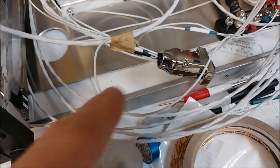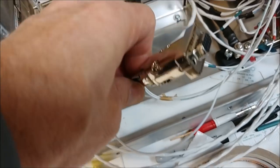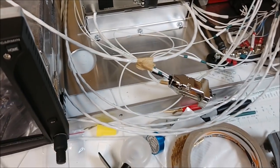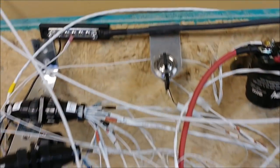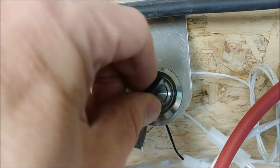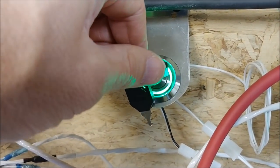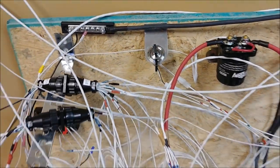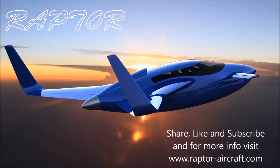Finally on the avionics, I got a bunch of other things done — the landing gear switch put in, a connector for the throttle, the aileron trim wires put in, and a bunch of other things. I even got the LED light on the key switch working, which is kind of neat. There's still more to do but I'm getting through it fairly quickly, and I think by end of next week the majority of the wiring will be done before I leave — exciting. I also want to run the engine again next week once I get the heat exchanger hooked up. Anyway, that's our update for the second half of this week — thanks for watching.